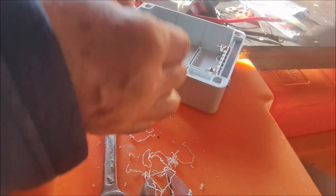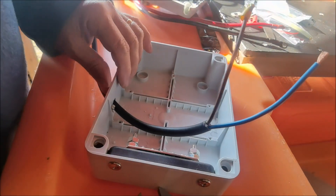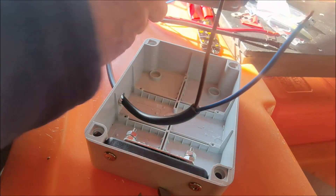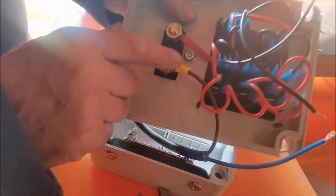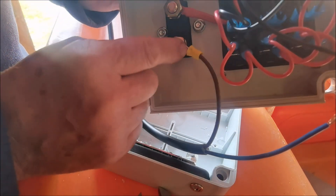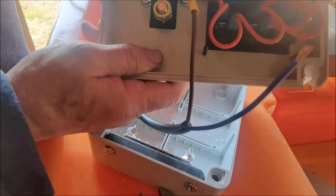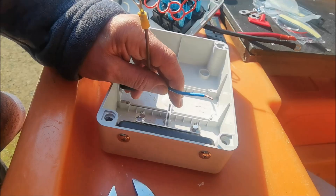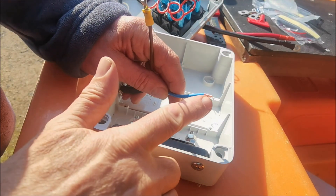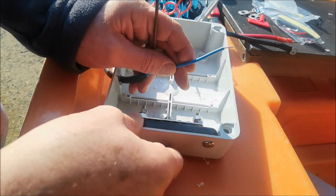Okay, so this is live from the battery — it did go through, just pinched my fingers a bit. This will then go here — coming straight from the battery, straight to the bottom of the isolation switch. Which then makes the switch live, so when you switch on it makes all these switches live. Next, I'll put a connector on this — this then attaches to the bus bar, which will be all negative.